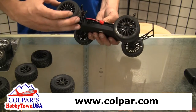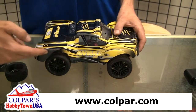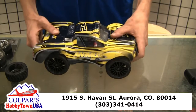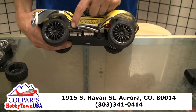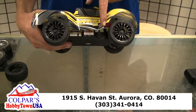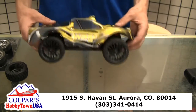You also have to cut out part of your wheel well here, because we were having issues where it would rub, especially when you came down on a jump. All you really have to do is cut out this little section right here. For those guys who like big air, you can also cut it out just a little bit here, which will help keep the wheels from hitting the body.